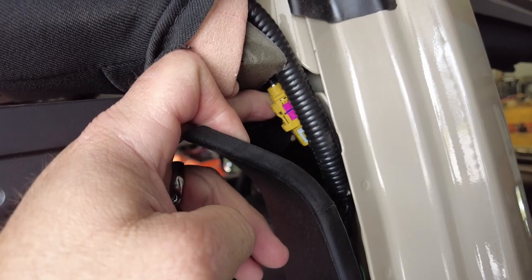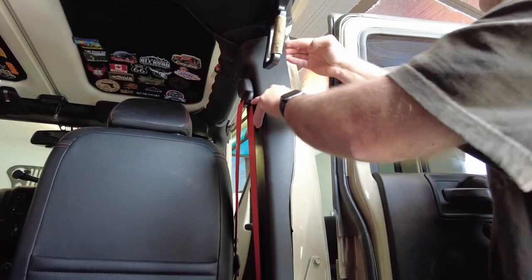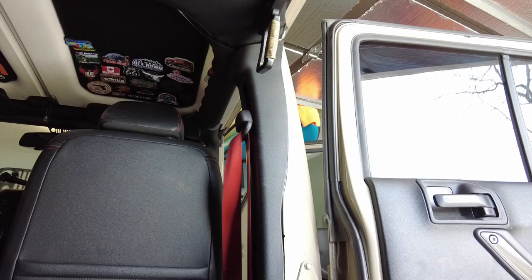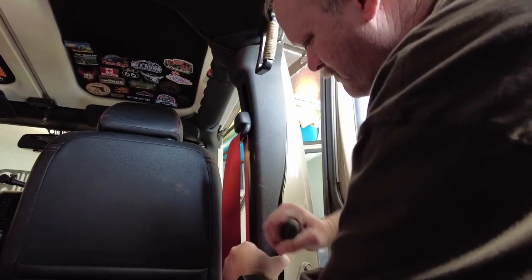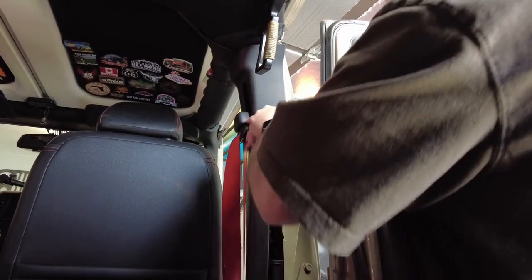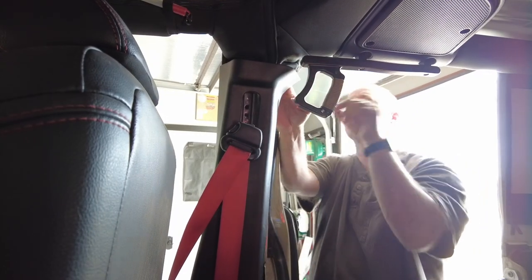Right here is the plug that you need to unplug for your antenna and your antenna wire. That's right at the top of your B post, right where my hand is right now. When you put a headliner in and you put the insulation barrier, if you accidentally cover that antenna, your satellite radio quits working. You put a roof rack on top of your vehicle that covers that, again, your radio quits working.